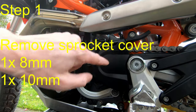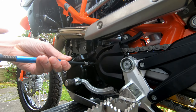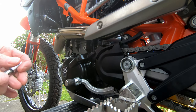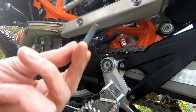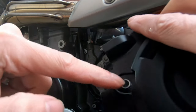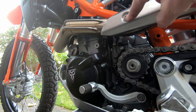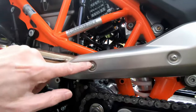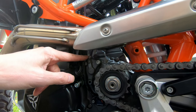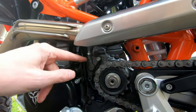The first thing I've got to do is remove this chain guard, or the cover — the sprocket cover. I might have a bit of a clear view if I remove this heat guard so I can see a little bit better. I think I'm also going to loosen the pipe work from the clutch lever itself, so that it's easy to undo later on.